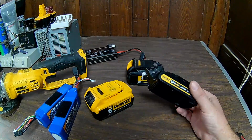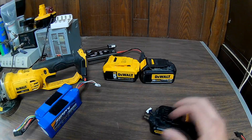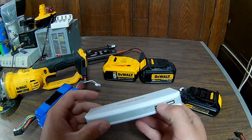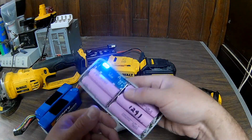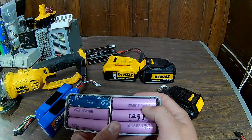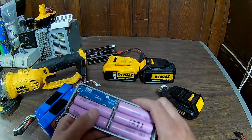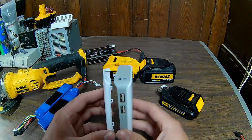It was kind of a waste to take this battery apart since it was a brand new refurbished battery. But I justified it by getting one of these power bank shells — it comes as an empty shell. The batteries that came out of the DeWalt were Samsung 18650-13B cells, where I think the 13 stands for 1.3Ah. I charged one up and measured it at 1291mAh, very close to the manufacturer rating — so now I have a power bank for my phone.